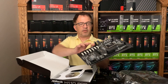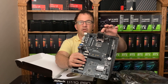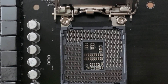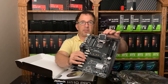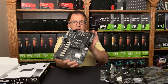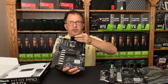The problem is we never checked inside the pins, and that's where I almost made a mistake. When I opened up the pins and was ready to seat the CPU, I was like wow — I could see the pins in there, probably about half a dozen of them were pretty bent. I don't want to chance bending them back; I don't have microscopic eyes to do it. I actually have another brand new ASRock, the same motherboard, without bent pins, and I'm going to show you them.